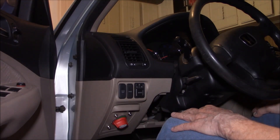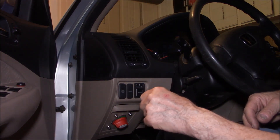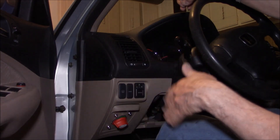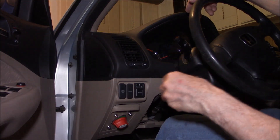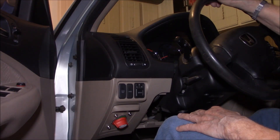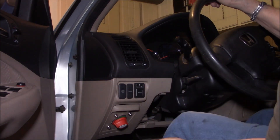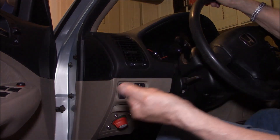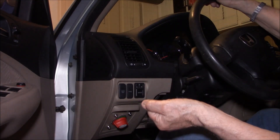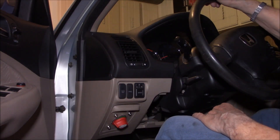I have a drain on this car, and I did the amperage test — there are some good videos on YouTube that show you how to do that. You essentially hook your meter on 10 amps between the battery negative and the car wiring negative, and then you can see the amperage that's being pulled with your key off. And still there's a draw. I just could not figure it out, and to get into an old car like this, especially since it was an intermittent problem, makes it very difficult. For old cars, it helps to put in a kill switch. They have ones with handles that you pull out — that seems really good — but I felt I'd have an issue remembering where I put it. So I decided to make it a more hard-wired contact, and I think this will work good for me.